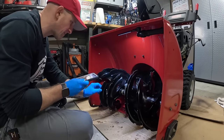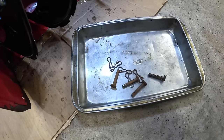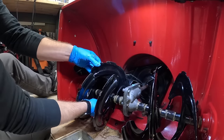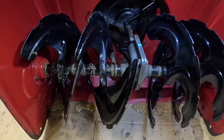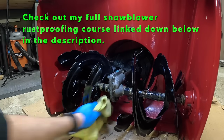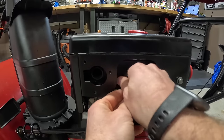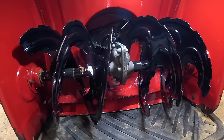From here I went back to the photo I took earlier and placed my augers into their proper position. I then took the extra step of spraying down my shear pins to prevent any future seizing. I reinstalled the shear pins back into their slots, locking the augers back into place so they move with the auger shaft. I wiped the excess Fluid Film around each of the augers — this will prevent the snow from sticking. Once that was complete, I reconnected the spark plug and these augers are now fully lubricated and protected.